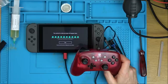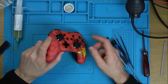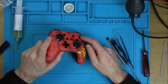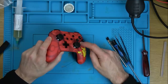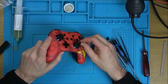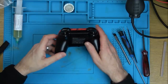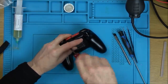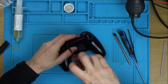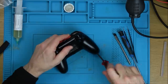Right, let's move on - we'll do the sticky button one next. With this one the buttons do work, so there's no point plugging it into the Switch. But you might be able to hear the difference. They just don't feel as loose as the X and Y. Even from repeatedly hitting them now I can already feel they're loosening up - I probably don't need to take this one apart. I could probably just clean it with some IPA, but let's just quickly take it apart - there's only seven screws at the back. We can properly clean it and also we might see some other damage. I can already see a load of crust has just come out of that bottom one. So maybe something was spilt on this one.